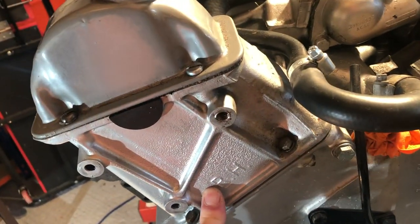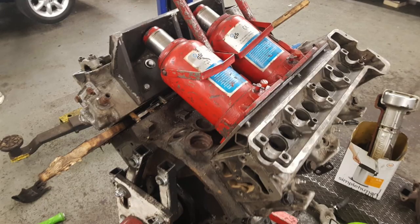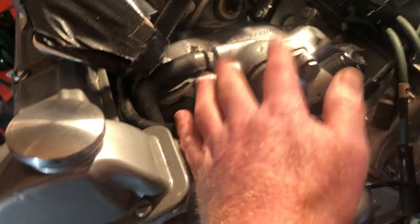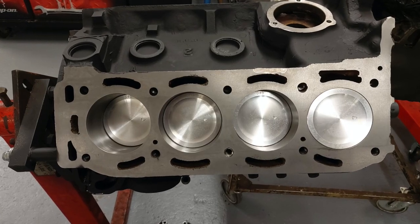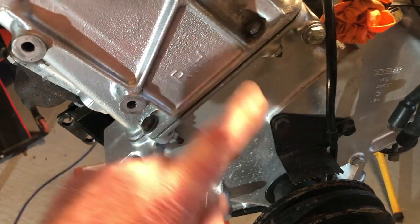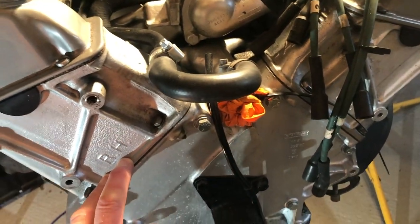At the front of the engine you've got your right-hand bank and your left-hand bank on the cylinder heads. These are quite difficult to remove, and on Saturday Sockets a few weeks ago there was a Rob Sport gizmo — basically welded together to exert pressure using hydraulic jacks to push these off. You've got various bolts holding the head on at funny angles, and because the head is aluminium alloy compared to the cast iron block, they tend to corrode between the two metals — especially with little antifreeze — and they bind together over the years. They're pigs to get off, as we all know.